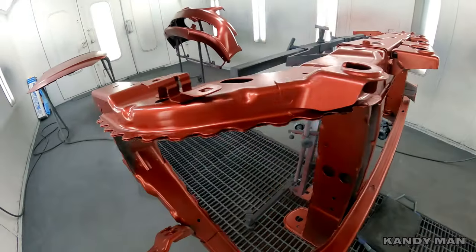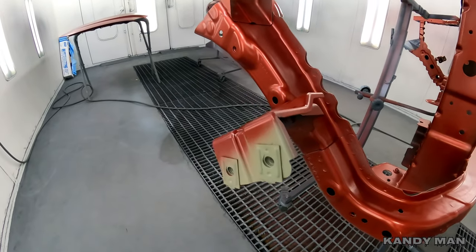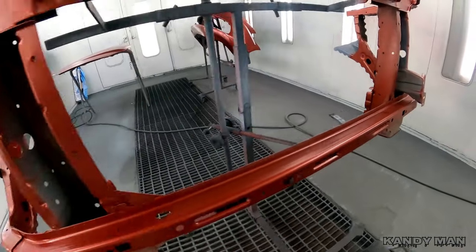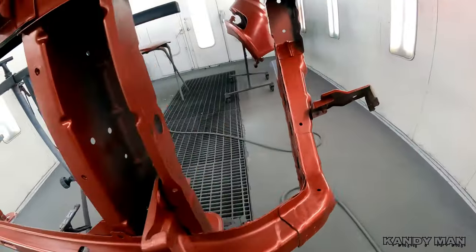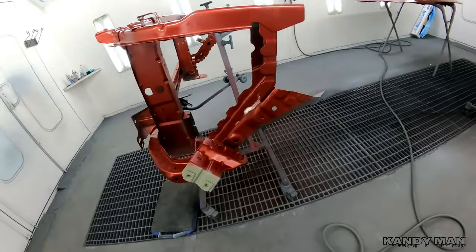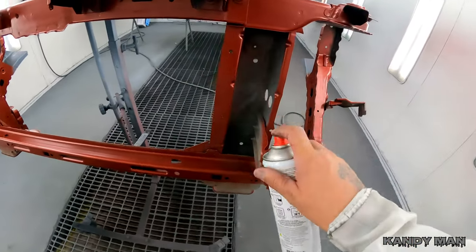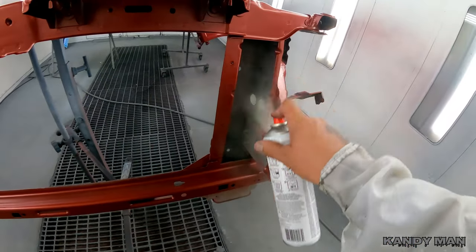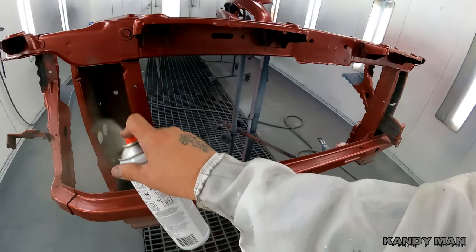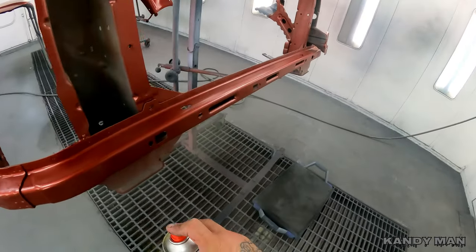All right, so I went ahead and put two coats on, and I still left some of my green on the edges. That way it looks factory, because you guys know I like to do stuff that looks factory. And I'm gonna go ahead and do one little trick that I like to do now to give it a real factory look, and that's to go back in now with the green, the E-coat, after you put the red on, and just fog it in certain spots that you know it needs to go to blend in nice, and it really gives it a really factory look